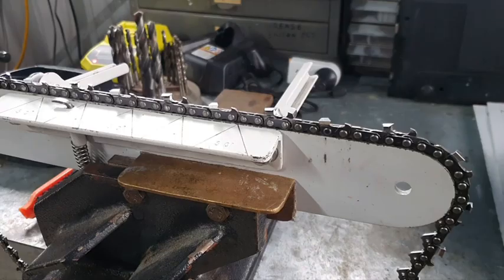So, I've got some notes that I can read out, but basically the current recommendation by STIHL is no tilt. Other manufacturers do recommend it. It's interesting when you look at the documentation and information as to why STIHL stopped recommending 10 degrees downward tilt. The main reason I can find is that people were over-tilting — they were holding the file way more than 10 degrees downward tilt and were stuffing the geometry up. STIHL realised that the amount of gain you get from 10 degrees downward tilt, as opposed to people stuffing it up, means the gain from 10 degrees downward tilt is minimal.